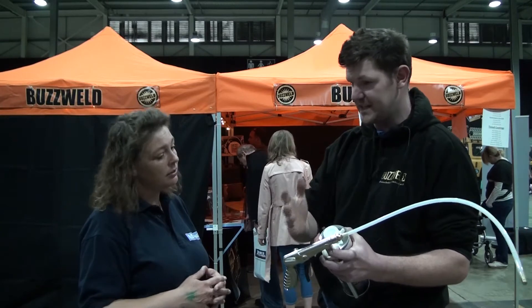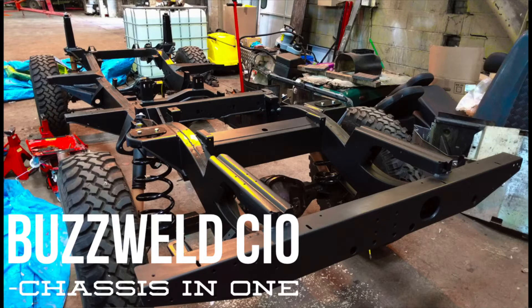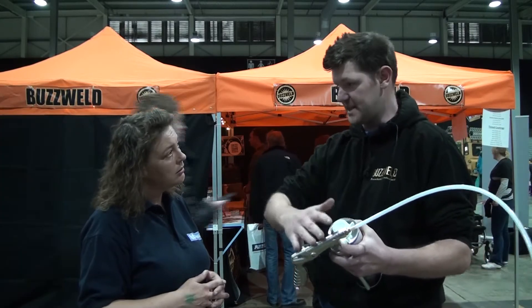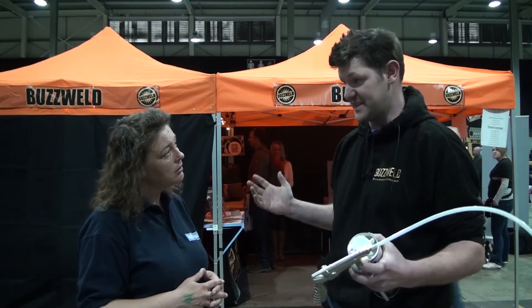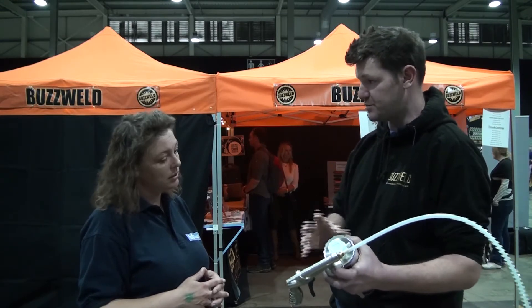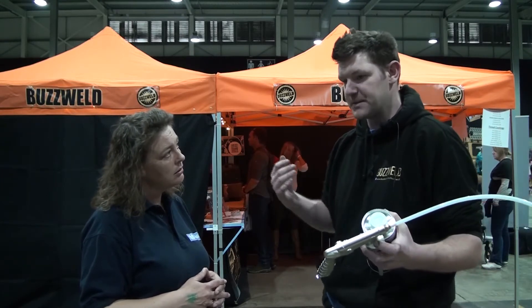A VCI — Vapor Corrosion Inhibitor — you put it in there and it'll release the vapor throughout the chassis for up to about four years. As long as you haven't got a large amount of airflow within that chassis, it will constantly protect the inside. And if you get any delaminated steel inside — if it starts to what we call 'biscuiting' — you'll get some delaminated steel come off and have more exposed steel where you would have sprayed previously, now left exposed. The VCI will now protect that area, whereas this wax will only protect anywhere you've physically applied it.